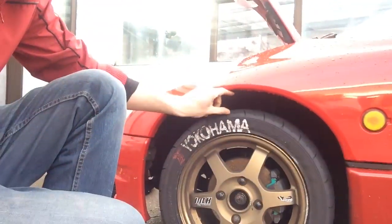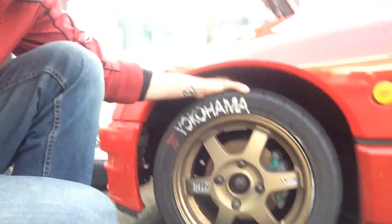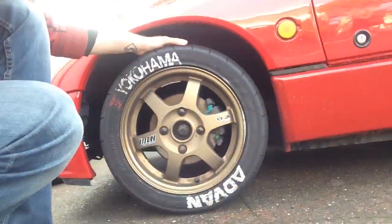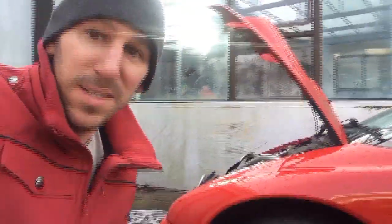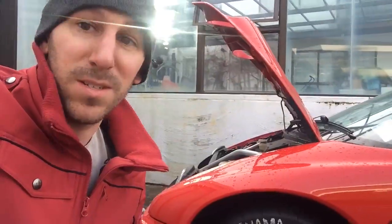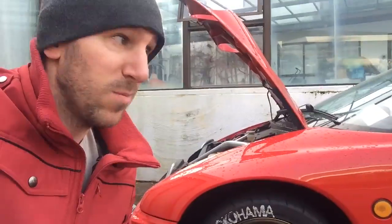I'm going to keep the ride height a little high so that when I hit bumps I don't scrape, because these are a lot wider than stock and the inside on full lock kind of scrapes. These are 165s and that's just about the limit - if you have stiff suspension it's fine, but if not, yeah, it's tough. I'm actually using 185s on the rear, and that's as wide as you can go without getting spacers and fender flares. So until I do that, I'm keeping these wide.